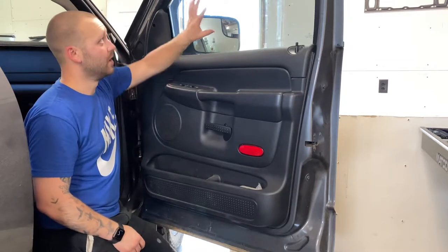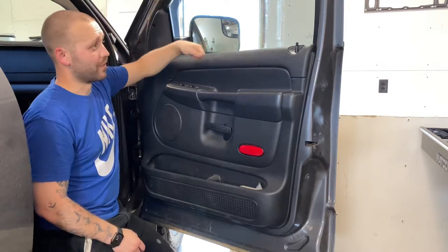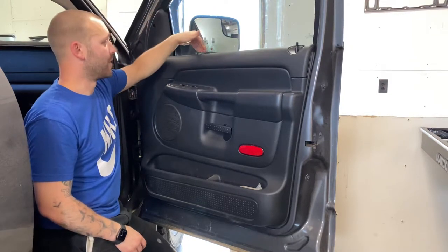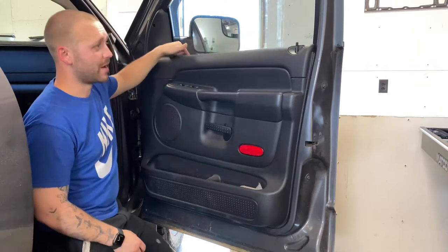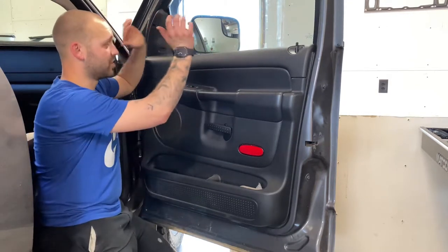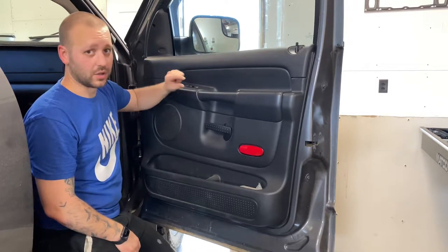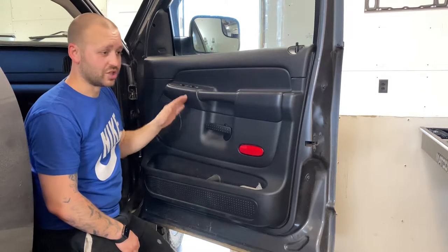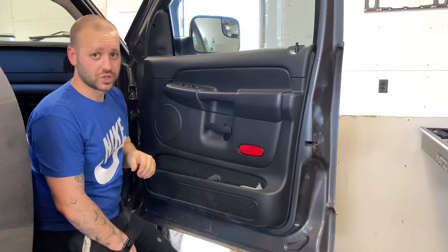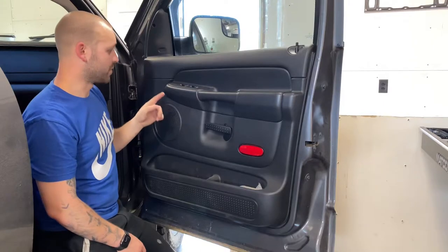For me, I'm actually removing the 35% tint and then going to replace it with 20% — the owner wanted to go a little bit darker. I just want to make sure there's no remnants of tint at the bottom. When I install tint, I prefer to have the panel off anyway. It allows me to install cleaner, cut the tint a little longer, get it below the gasket. It's just a preference of mine — a little extra work, but a little more insurance.